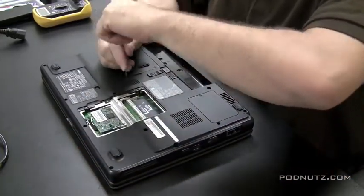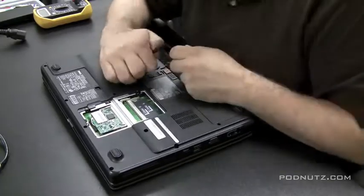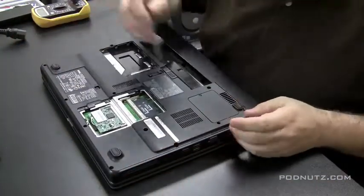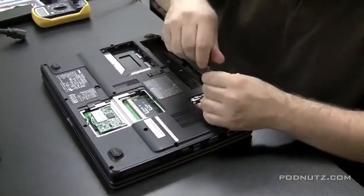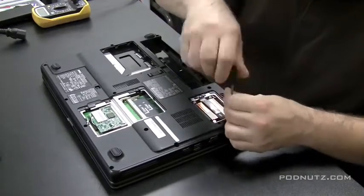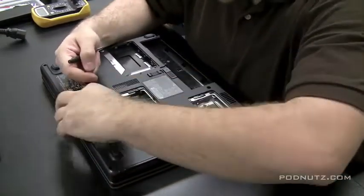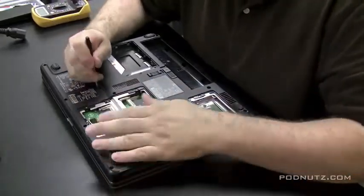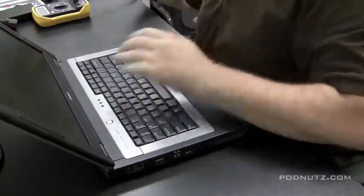The reason I do this is I want to get everything out of the way since I'll be working on the motherboard - anything attached to or touching the motherboard that could be loose I want removed first. There's a little flap I lifted that revealed the heat sink sitting on top of the processor, so I can take that off as well. I'm pulling off the wireless card - I'll explain why that's really important a bit later. One screw and the CD drive comes out.